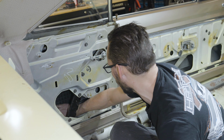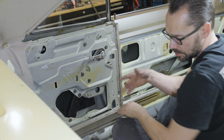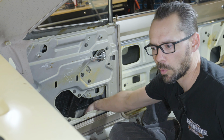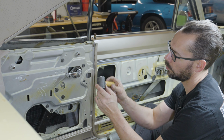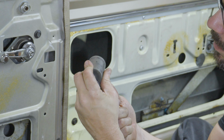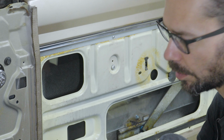Now you can use a little roller, which I have. I'll go grab in a minute, to press that down a little bit, because it's hard to get in there by hand. But this one, it's a little bit more of a thud over here now. That side's a little echoey. Can you tell the difference? All right, so this is the kind of roller you want to get. It's got a little rubber wheel on there, so it won't leave gouges on the outside of your panel if you push too hard accidentally.